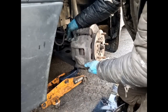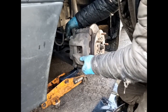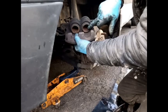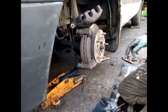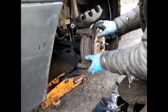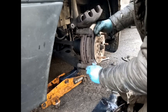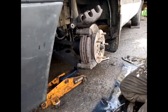But it went loose. See how it's loose now? It went loose because when I tilted this caliper, it forced these pistons in. And that means now that there's clearance. If I'm careful, I don't need to touch those at all. I can just pull those pads out just a little bit and I can leave them in position, because I don't want to keep messing with things. So that'll do it.